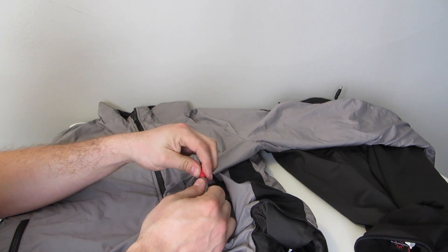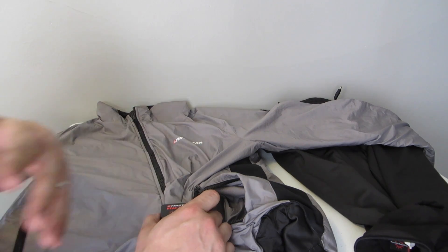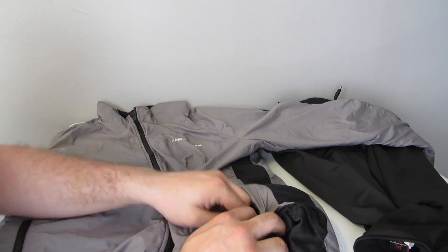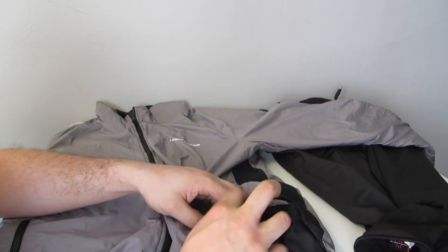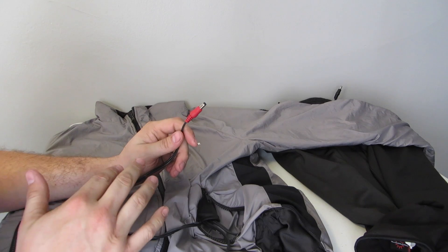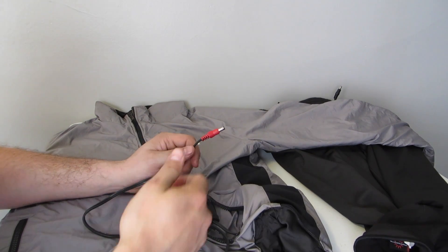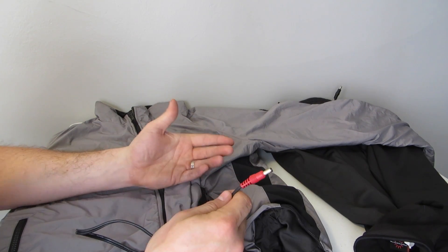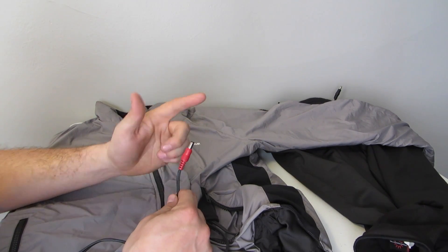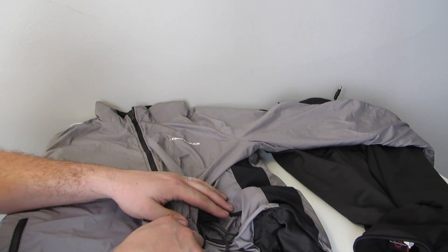Red to red — this is how your heat troller gets the signal from your wireless remote about how high to heat your jacket and glove liners, which are part of your red zone, because your gloves plug into your jacket. The yellow cord handles your lower half. The power supply cord plugs into your battery identical to a battery tender — ground to ground, positive to positive. The cord that stays on your bike has a waterproof cap, so you don't have to worry about anything in the rain.